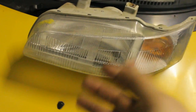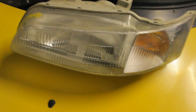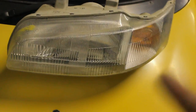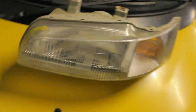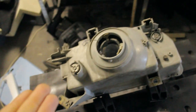The first way you can solve this is by painting over the upward-sweeping part of the Japanese beam — painting everything black so no light comes through, giving you a flat beam. This is perfectly legal in Holland, but it's also incredibly ugly and I'm not going to do it. The only way it's legal is if you paint it from the inside with heat-resistant paint, since the headlights get rather hot. My advice: don't do this.